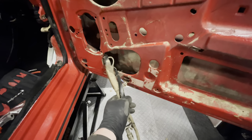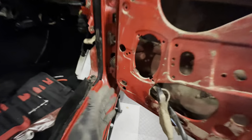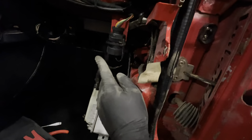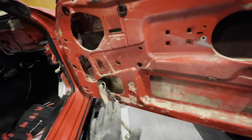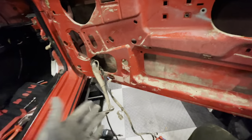I've been struggling with the door harness. I expected to just disconnect it, and on the Safari it does have a connector right inside the A-pillar. But on this car there's no connector inside the door. I pulled the carpet out again, traced the cable, and even removed the computer to check underneath — no connector. This wiring harness just keeps going into the car, so I'll have to clean it in place. At least the door is now pretty much barren and empty.